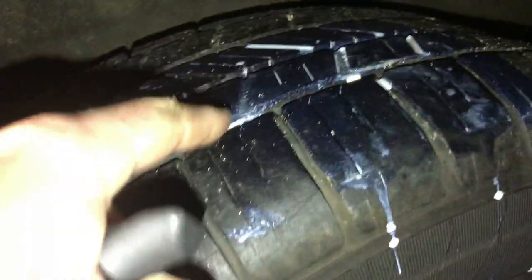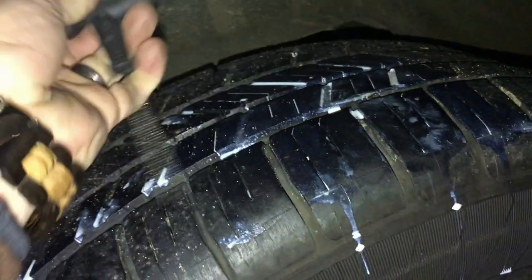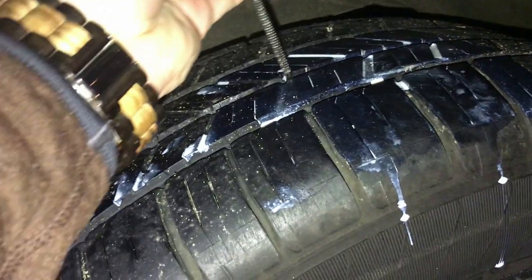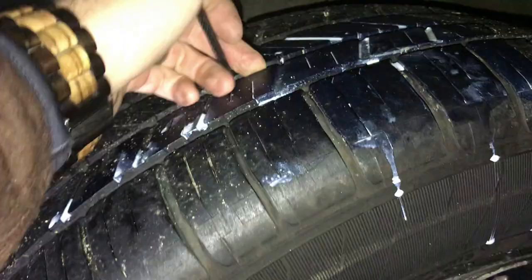Let's go look at the tire. You find your hole by basically spraying something on it — I found my hole right there. You take the punch tool and put it right in that hole, then work it up and down to make the hole big enough to get your tire plug back in. You can see it's going in — I worked it in. You never even take your tire off. Now we've got a bigger hole, so let's get it ready.